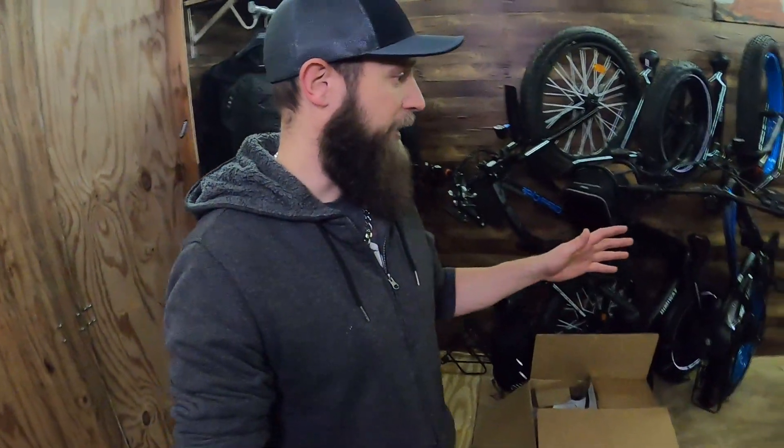The Himiway is out of here. I put the Himiway motor back together — it took me seriously like 10 minutes. I'm getting pretty good at that. I put some white lithium grease on the gears inside and popped it back in and screwed it shut. I'll link what I used in the description — it's just multi-purpose white lithium grease I bought on Amazon.